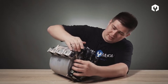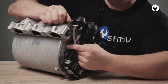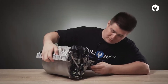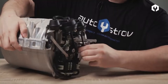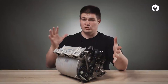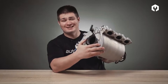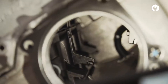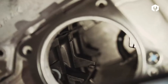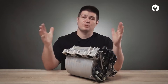In this model there are two flaps, each responsible for three cylinders respectively. This is the right three cylinders and here is the flap — now I'm going to move it. And on the other side there is the same symmetrical flap — I'm going to move it too. Let's try to see what's on the back, on the side of the entrance, and how these flaps are moving there. So we have looked at the first way the flaps open and how the length of the path the air passes through changes.